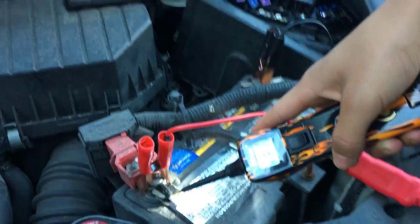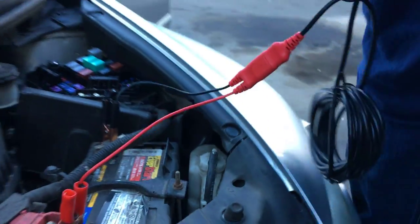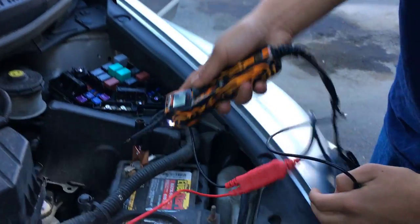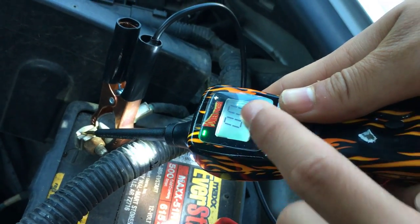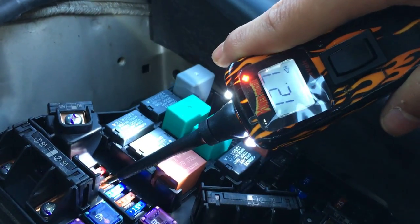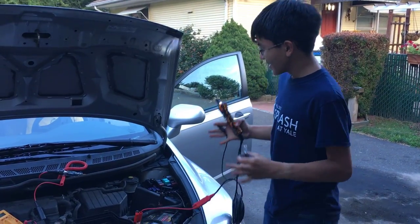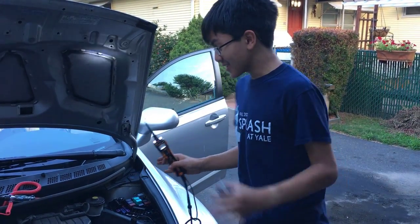Let's try it. You can hear the noise — it also flashes red and shows a number which is 12.7, that's the voltage. And if you put it to ground it's negative: it has a different tone, it's green and shows zero. So if we put the tip at one of the fuses, it shows 12.7 and positive — it's also red.